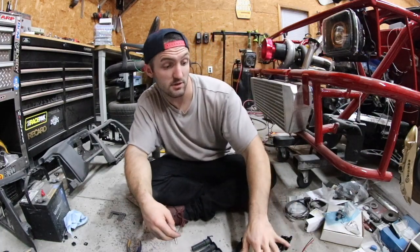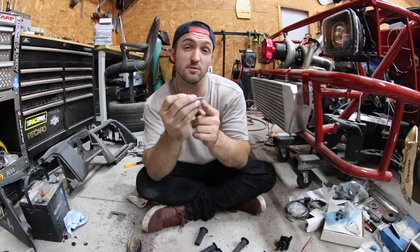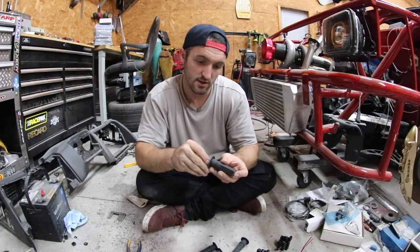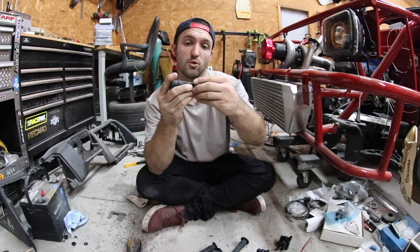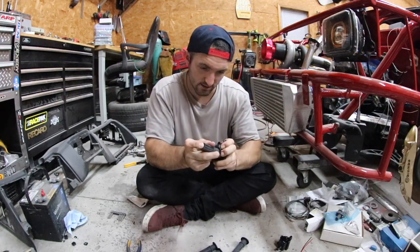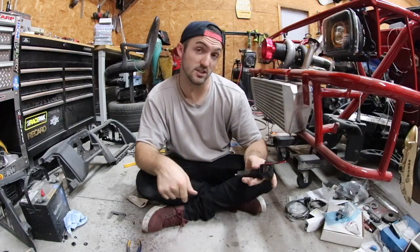I've got all my boots cut, all my springs cut, and all my bolts out, so we can put them back together. Put the connectors on, set them in, and check the position to make sure they're all at the same height. Take your spring and slide it in — I chose to do it so that the smaller end mates with the top of the spark plug. It's easier to shove the other end up into the coil because it has a little locking area and it just sits inside there. Slide it inside the boot, leaving it poking out a little on the bottom. The top of the spark plug will go up inside the boot a little bit and the spring will make contact with it for a good solid spark. Slide it into the bottom of the coil and then spin the boot around until it locks into place. The spring is designed to compress on both sides and through the center, so it'll push all the way in and sit on your plug. Now I'll grab the Toyota electrical connectors, throw those on the coils, and get them lined up.